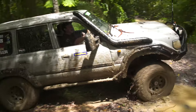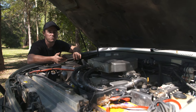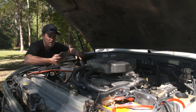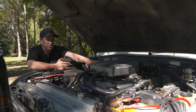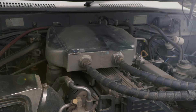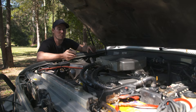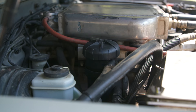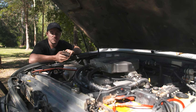Torque is a big one — you want to make your torque early in the rev range. That way when you need your power getting into a bog hole, you can put your foot down and get out quickly. Those with high horsepower usually make their power later in the rev range — no good for off-road driving, good for impressing people on the beach maybe. Engine mods are pretty basic — it's got a water-to-air intercooler that was on the vehicle when I bought it, a catch can, and a secondary filter. Apart from that, it's all pretty much standard 80 series.